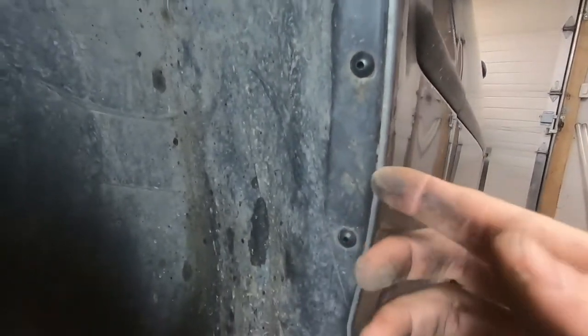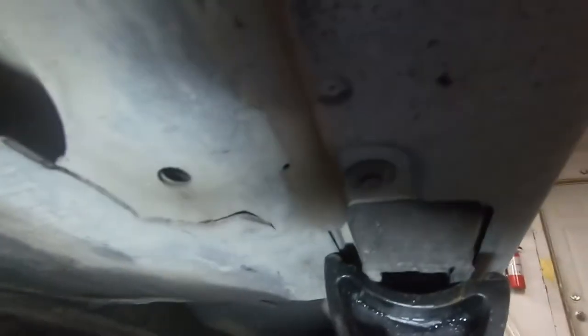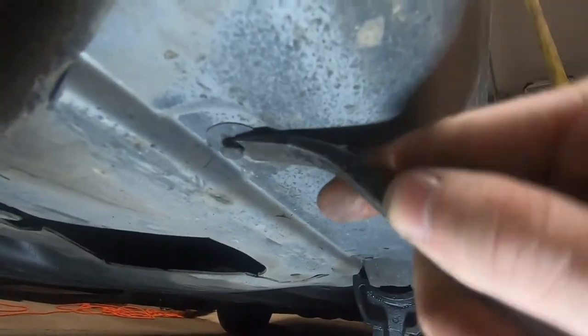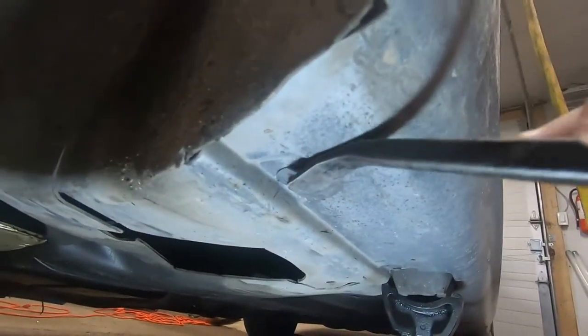I now have all these bolts undone all the way around and I've also pushed out the centers of these clips, so when this gets pulled back these will pop out. Now you have to go underneath the vehicle just under right here and undo a few clips. In this vehicle there are two clips you need to undo to pop off the side skirt, because the inner liner goes underneath it. There's this clip here and an identical one just a little bit further back right in front of the jacking point. To do these you have to pry out that center piece and then the rest of it will come out — just take a screwdriver or a little prying tool and pry out that center.